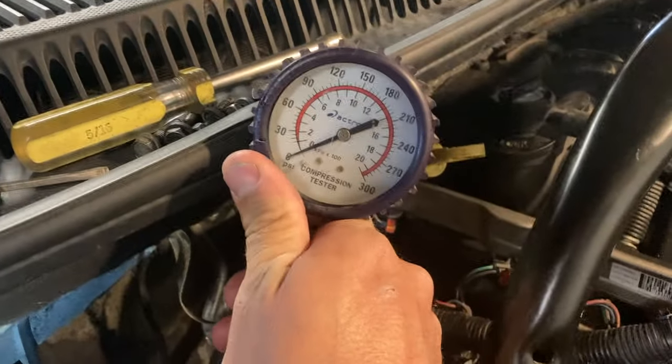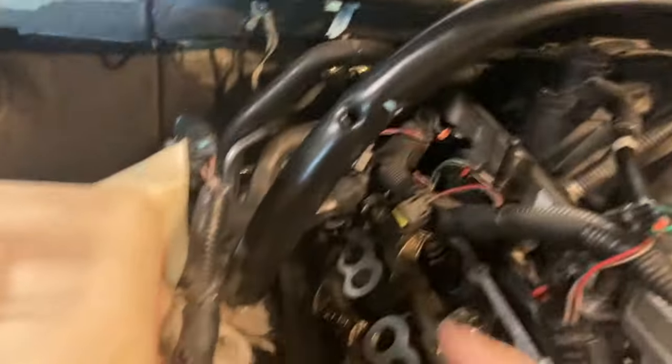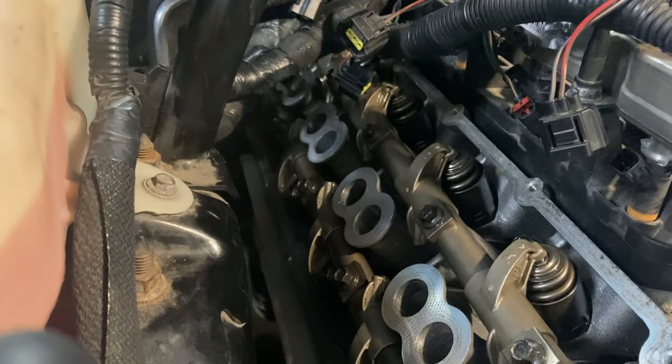Compression was another thing that came up. Did I verify compression? Maybe I had an issue with the head gasket or made a mistake somewhere. So I got out my compression tester and started going cylinder by cylinder, as you can see here in these pictures. Every cylinder looked good until I got to the last one, back by the passenger side — zero compression. I then used a makeshift leak-down tester. I pulled the whole rocker assembly and push rods off to ensure all valves were closed, then did a leak-down test on that cylinder. With the rocker assembly removed, that cylinder held just as well as all the others.